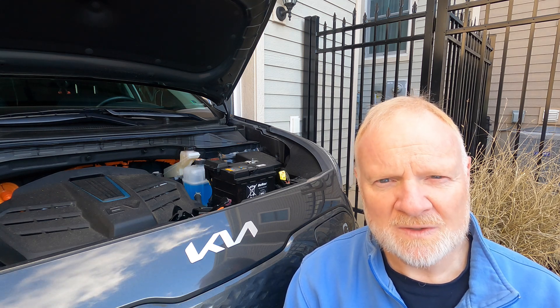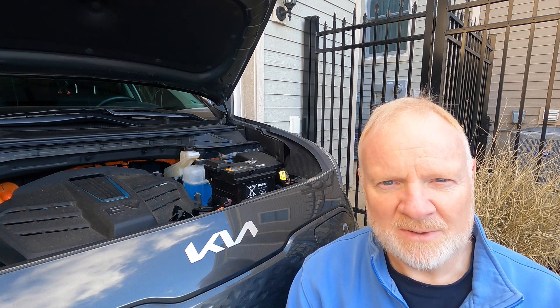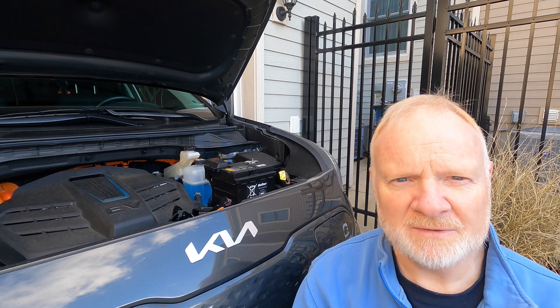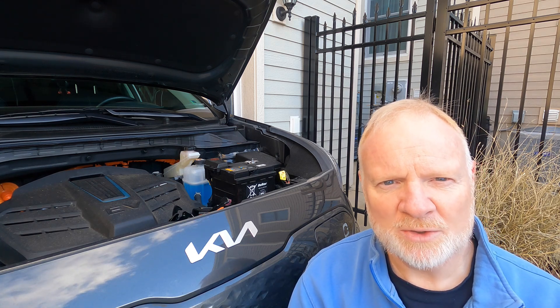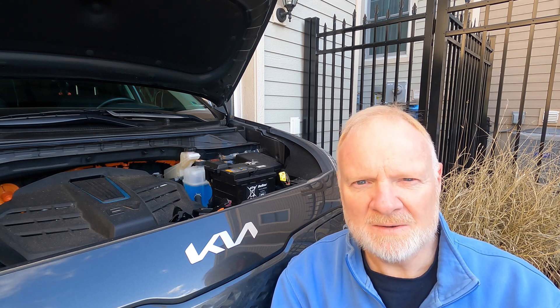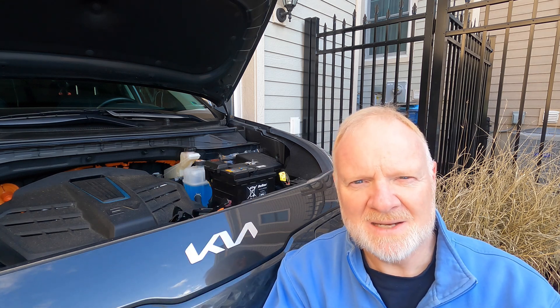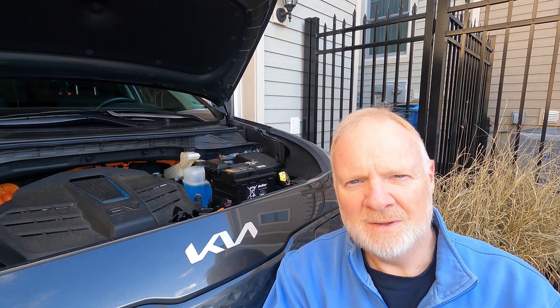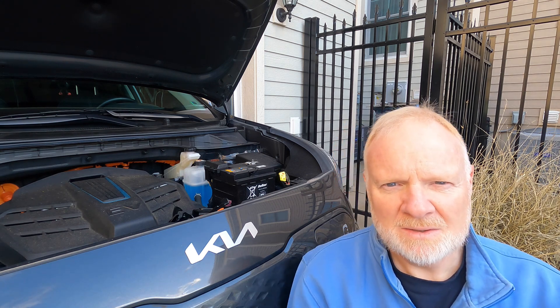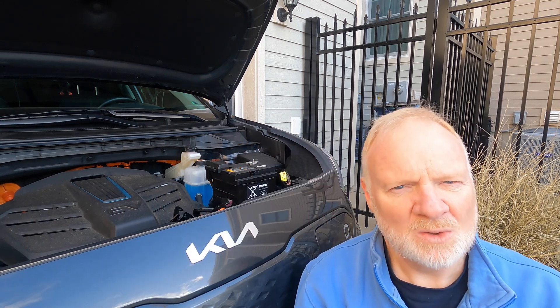You're going to pay a core charge, which is a deposit, and you'll get that back when you bring the old battery back. Short of that, one of the things you can do is carry one of these jumper packs, and you can also jumper off of another vehicle to get the 12-volt going again. But obviously that's a short-term fix — you want to get that battery replaced so that you're not stuck. As for jumping an ICE car when they're stuck and need a jump start, I personally would not recommend that from one of these batteries because they're not designed to do that. They are not designed for cold cranking amps; they are designed to run the electronics on this vehicle. Unless you want to trickle charge their 12-volt from your 12-volt for a while, I wouldn't keep it connected while they're cranking. One of these jumper packs is the way to go, or AAA.